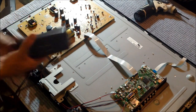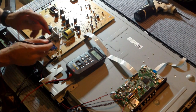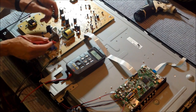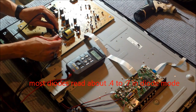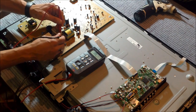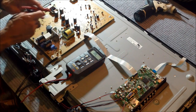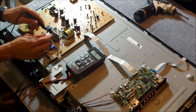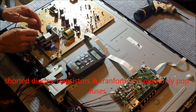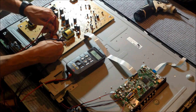Let's try to find out where the short is coming from. We know we're getting a short — there's a short in the circuit. Let's find out where it's stemming from. We're going to test some parts in the power supply. The things I look for are diodes. A diode is basically this black thing. This one's good — it reads 0.4. The other way it reads pretty close to open line — OL. It reads 0.4, it's not reading short. I found the shorted diode. And this one's good, and this diode's good, and this one's good — and another shorted diode.